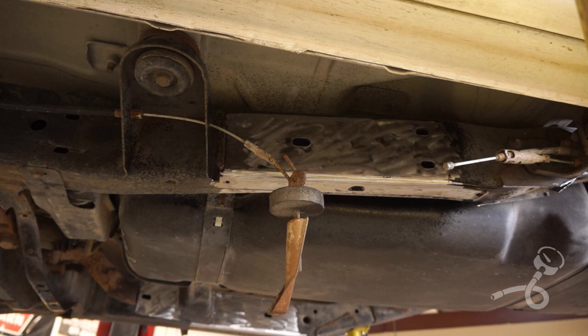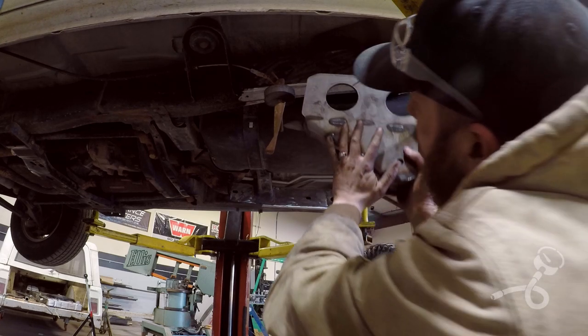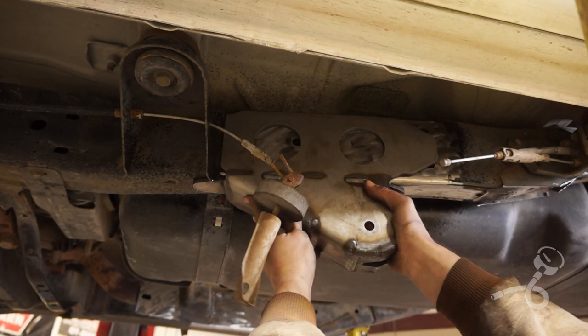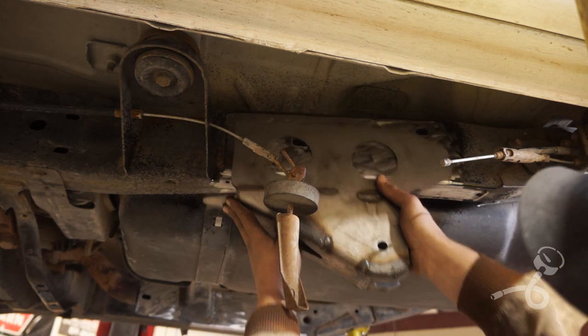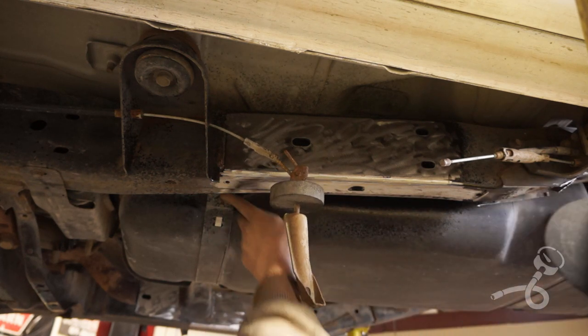Okay, my mount has cooled down enough finally to where I'm thinking about tack welding it up onto that frame. We're gonna get our first look at how it fits. And it looks like it fits pretty good. It's designed to basically almost bottom out up against this weld on the body mount here. So to get about there, it looks like I need to cut back a little bit more of the paint back here.